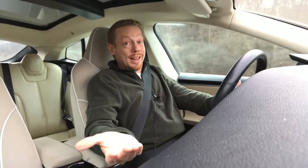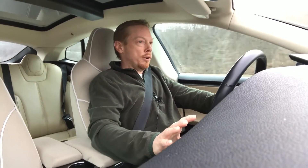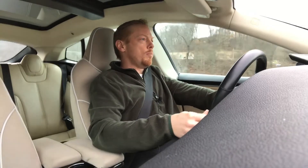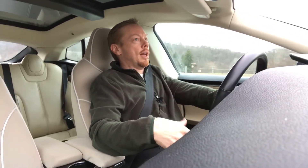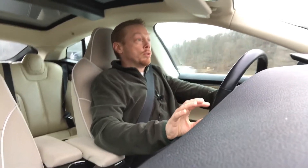That seems to be a very rare occurrence. What has more commonly been done — and I've read multiple accounts of this — is somebody taking the secondary charger and moving it into the first charger position and then just trashing the first charger. Or if you're out of warranty, you want to keep it because it's usually a fuse that can be replaced, but it's a solder fuse — it's not a fuse that's intended to be replaced. So you can do that on your own and you'll have a good charger, albeit not actually mounted in your car anymore. We'll see a lot more of this as the cars age, and more people start doing out-of-warranty work themselves or going to independent shops.